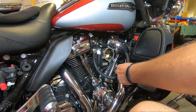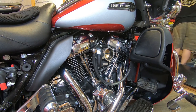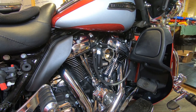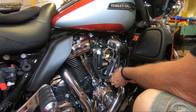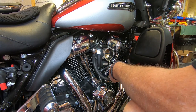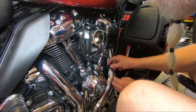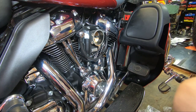You'll notice that I used silicone — I sprayed it into the hose, which makes the hose much easier to put on and off the barbs as you're getting the fitment right. I cut a few times to get the length just exactly right. I used the black tee — the kit comes with a black tee and a brass tee, and I used the black plastic tee to help keep it more hidden. Instead of using the included hose clamps, I like to use the black zip ties, because it just does the job and it's a more discreet installation. You'll see that I have the hose routed down into the front, away from the exhaust, not near anything hot, and down to the floorboard. Sorry that the audio cut out — hopefully this explanation helped a little bit.